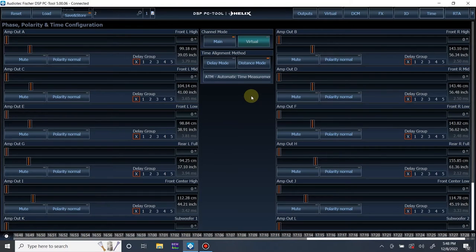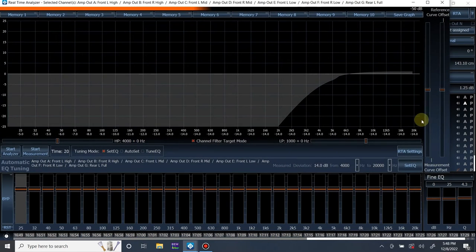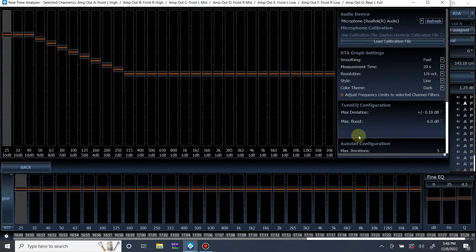And the fact that we did impulse response with the software and it lined up perfectly or nearly perfectly with measurements with the tape measure, we know there was actually no signal delay applied between mid-bass to mid-range and mid-range to tweeter. Now we're going to start tuning the outputs. It's actually been a while since I've used this method, so I'm going to have to brush up really quickly. Give me 1 second.